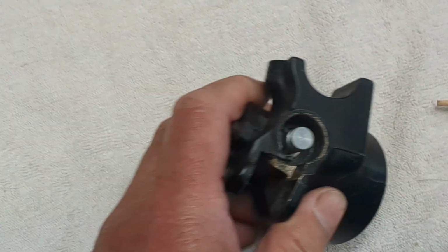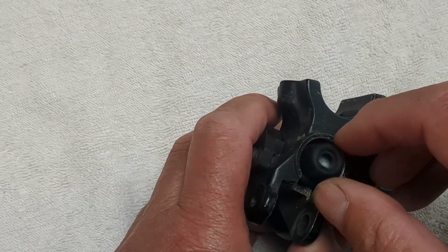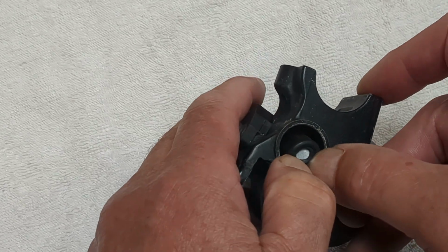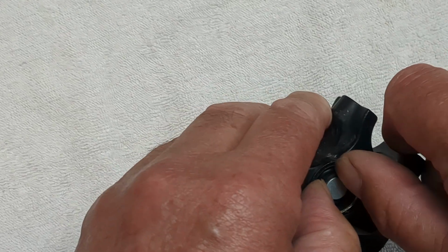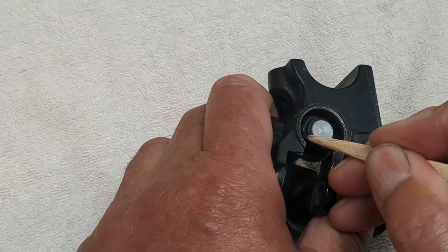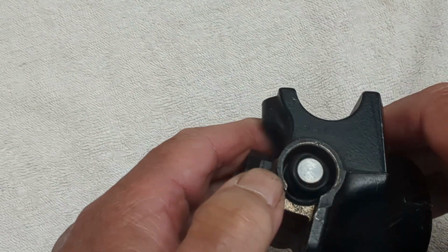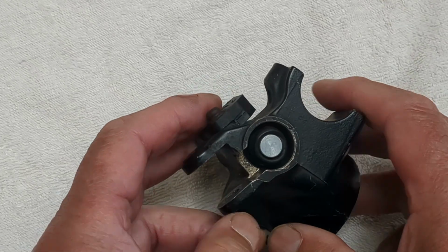Okay, this top hat is to weatherproof everything really, and to prevent leaks. So it sits over the top of the piston and will eventually cover the circlip. So all you do is manipulate the top of the collar so that it sits in the recess at the top of the piston. And there it is. Okay, weatherproofed, fluid proofed hopefully, and that's the job done.